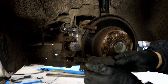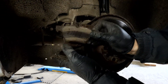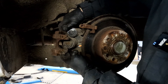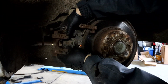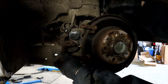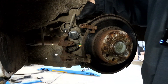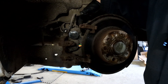The pads are coming out — that's the other pad. They're pretty much done. Now looking at the caliper, this is where you check the seal to make sure there's no damage and make sure it's nice and free for us to turn them and wind the caliper back in. Because some of them you can push back in, but this one you actually have to wind it back in. At this point either put some cable ties to hold the weight off the caliper or leave it resting if you can. There's a plug for the electronic control unit — make sure you either unplug it or leave it there. I will leave it because I don't like unplugging it, and just make sure you don't pull it too far so it doesn't damage anything.